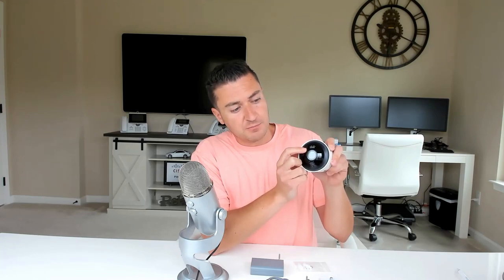If you take a look at the front, you'll notice a little pinhole thing up top. This does have a built-in microphone, so it has voice capabilities right there — you'll be able to record. And on the actual camera itself, this is a 1080p camera. It has a 103-degree field of view horizontally and a 76-degree field of view vertically. It does have IR capabilities, so it will illuminate and you will be able to see up to 26 feet in the dark when the IR capabilities are active.